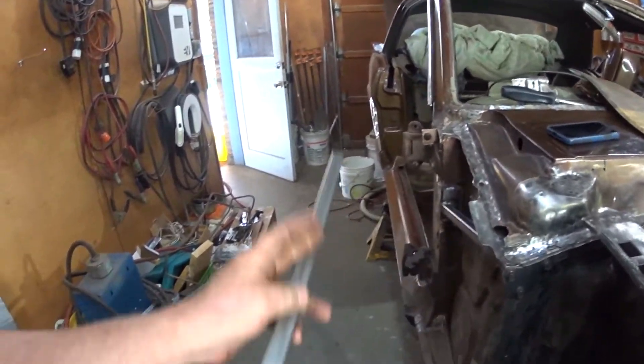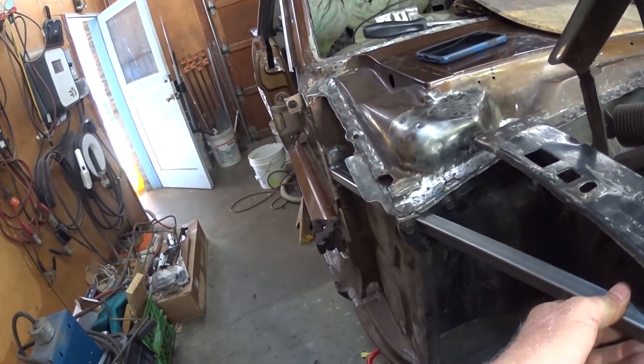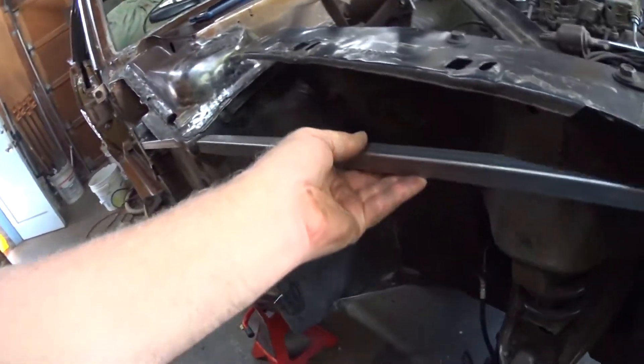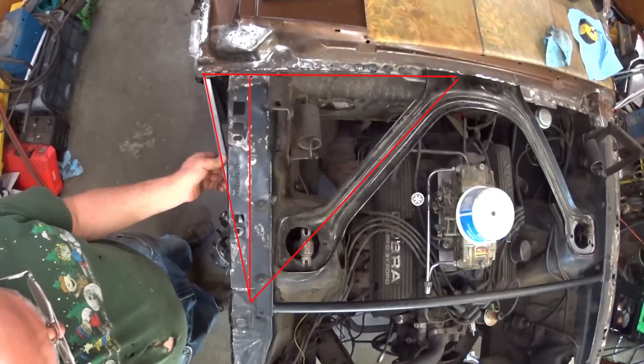The strut is already cut off at the angle it needs to be right there. I can't weld this in yet — I'm not going to do the final fitment of this strut until the car is sitting on all four wheels. So there's my idea: I'm just making triangles. This one here supports the A-pillar and hardens up that front point of the cowl, and these here should stabilize the shock tower both vertically and horizontally. Thanks for watching — I hope you like my idea. I know Betsy will.